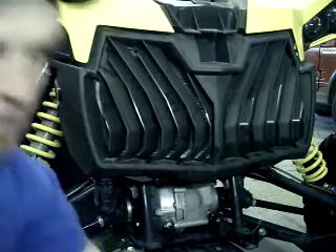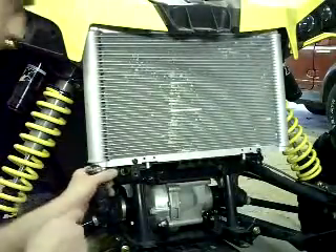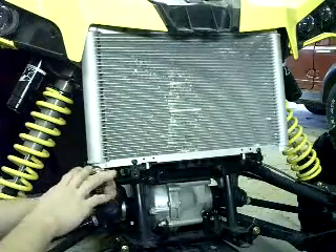Now it's loose, just hanging there. There are two little plastic push pieces just inside the slot here on both sides. All you need to do is simply pull the grill forward on both sides — it will pop loose. Go ahead and slide that plastic grill down to where you can access the radiator. Now that you can access the radiator, go ahead and start draining the fluid.